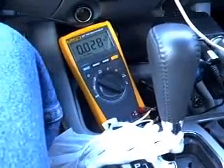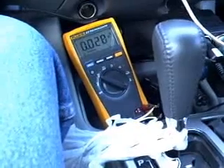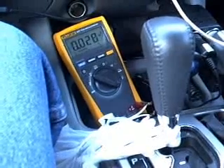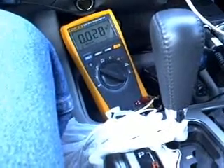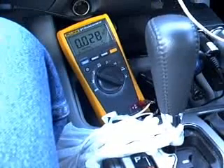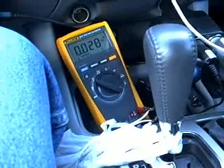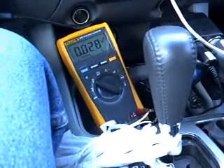Let's say the cell started out at 35 amps — that's the amperage draw I want it to take from the vehicle. If under normal conditions it were to go up to 70 amps, the pulse width modulator circuit will be sending approximately 50% duty cycle to the cell, meaning it will be pulsing 70 amps half the time for an RMS current value of 35 amps. I'm interested to see whether the peak value current has an effect over the RMS value current going into the cell.